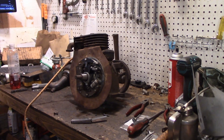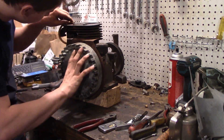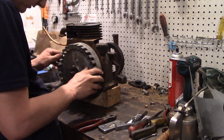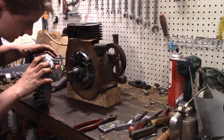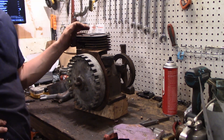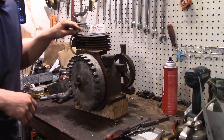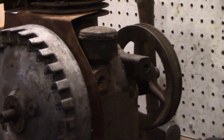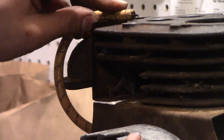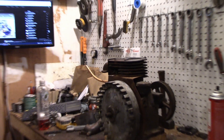Throwing the key in, grabbing the flywheel, sticking it on - let's make sure we still have spark. Got the flywheel back on, cut the plug wire to size - and we have no spark. Obviously I screwed something up. I fiddled around with the points and figured out that A) they weren't closing like they should have been and B) they were still dirty. So I took a little sandpaper, cleaned them up, and now - there you go, you can see a good spark. Pretty happy with that - it just means we can move on to the next disaster.